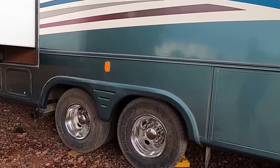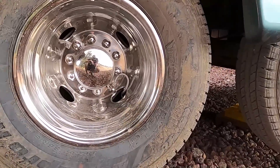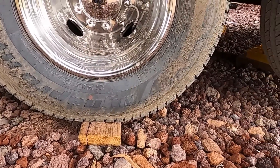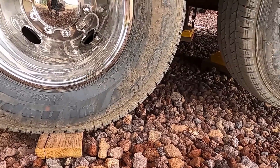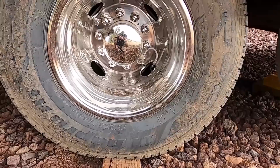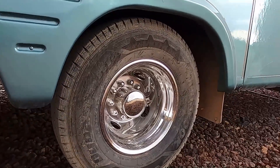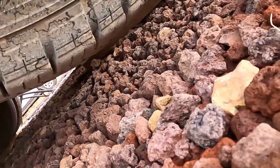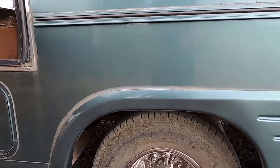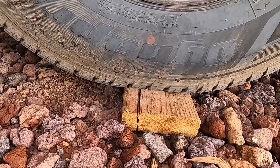I didn't come up quite as high as I should have. The back of the RV — this is the position it's going to be parked in most of the time, backed in — you can see the back end is up off the ground. I have it raised up properly. When you have hydraulic jacks, you can lift the back end of the RV completely off the ground, but you never want to pull the drive wheels off the ground because the parking brake is on that set of drive wheels. That's my tag axle — it has no suspension, so it is literally off the ground. The right way is to put it up on blocks and then lift it up on the jacks from there. The sag on that tire tells me I still have weight on the suspension.